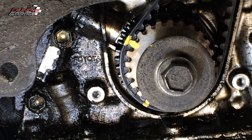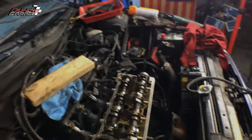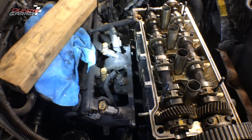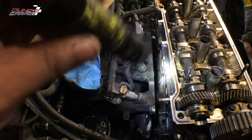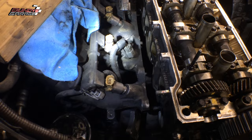I'm just showing you the mark I made on the timing belt and the gear itself. To get the head off, I didn't take the intake out. I just disconnected the bolts and nuts that were actually holding it onto the head. Once you get that off, the intake separates from the head pretty easily.